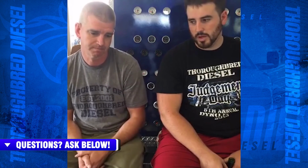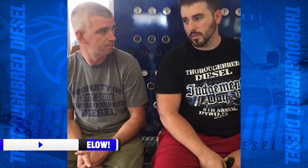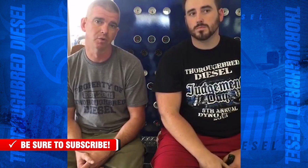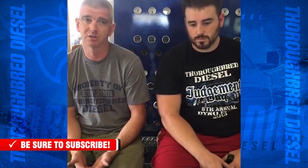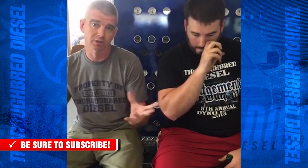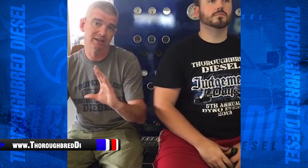Do you want to talk a little bit on if you're putting a lift pump on an OBS with the dual tanks and how you do that? Maybe that'd be a good thing. You really want to bypass the switcher valve in that. I can't remember off the top of my head exactly all of the hydraulic fittings, but you can pick up most all the fittings at your local hydraulic shop. It's probably really easier to just pick one of the tanks and go with front or back tank, and then you take out a lot of restriction there too. You can also fabricate your own switcher valve inside of that, but that's a little bit more advanced fabrication class. So pick one of the tanks, work from one of the tanks, and you'll save yourself a whole lot of trouble.